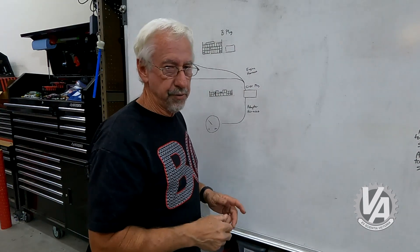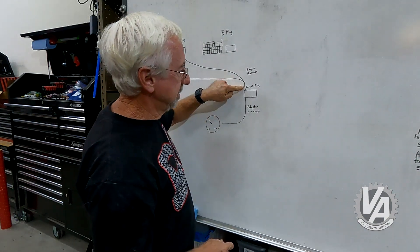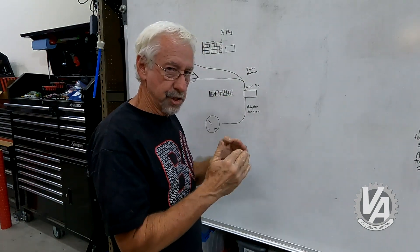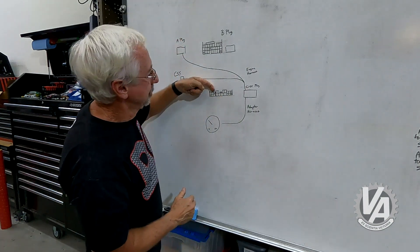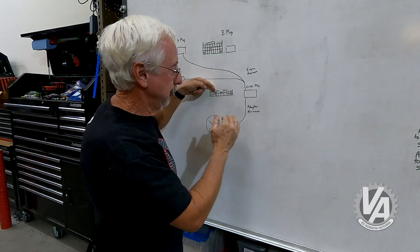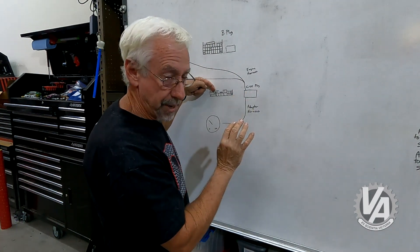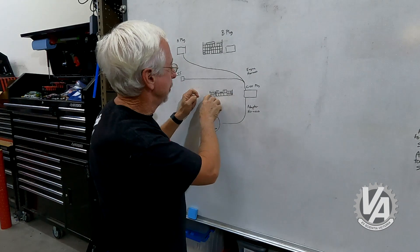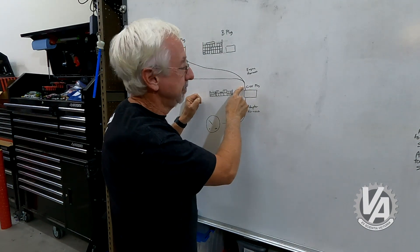You go four or five miles an hour and the speedometer reads full blast fast. So this is how you get rid of that problem. The first thing you need to do is disconnect the wire at the C-101 plug. The C-101 plug is that large gray plug that interfaces between the adapter harness and the engine harness. At position number three — when looking at the female plug, turn it so you see where the wires come out the backside; count from the top: one, two, three — that's going to be the white-green wire, which is your VSS signal. We're going to pluck that out.